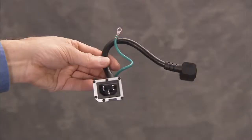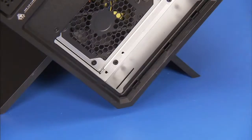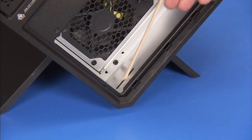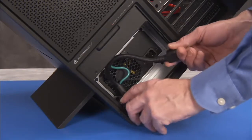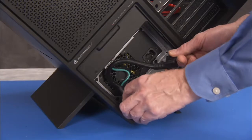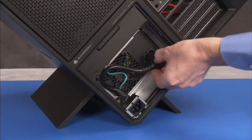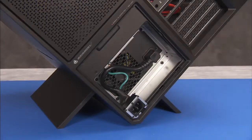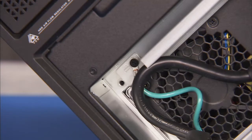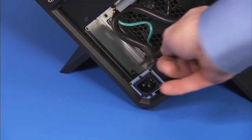The AC inlet end of the AC adapter cable for the power supply has a rail on one side that fits into a slot on the power supply cage. To replace the AC adapter cable, first press the AC inlet into place. Replace the power supply end of the cable to the power supply. Replace the Phillips No. 2 screw for the grounding tail of the cable in the fourth stencil location on the rear of the power supply. Replace the hex screw to secure the AC inlet to the bottom of the PC.